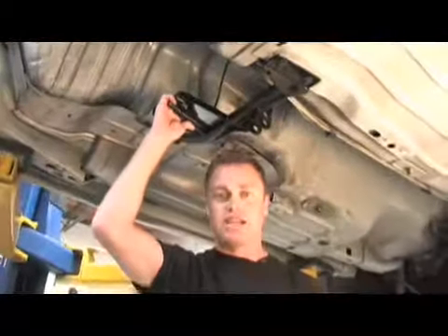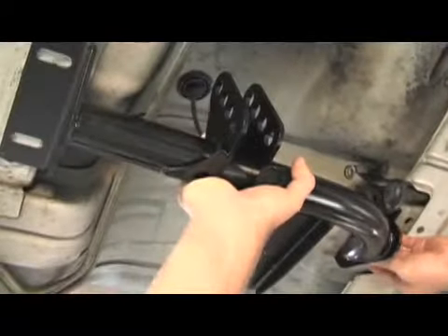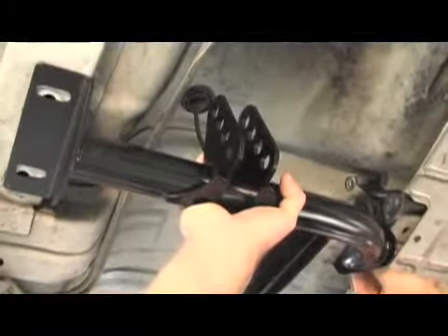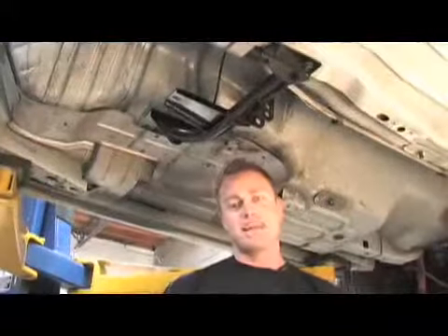With BJ finished with the M9 assembly, it was time to get the crossmember in place. It mounts pretty simply without welding — just bolts directly to the floor here and here, although if you've got a roll cage, you can weld it if that's what you choose. One unique feature of this crossmember is that it has a torque arm mount point. The stock crossmember mounts to the transmission; with this one, you don't need to. Now let's get that M9 in place.